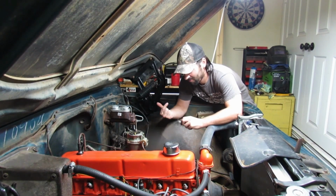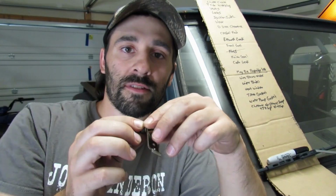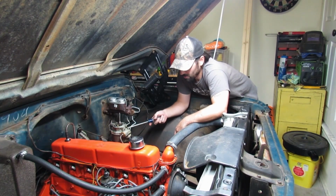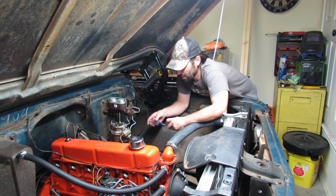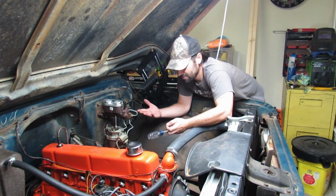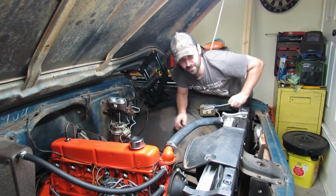If you take the bracket or the washer away, or both, it will grab threads and tighten up. We're gonna go with that because we don't wanna tear this all apart so that we can get in there and fix these threads when there's a chance that just tightening the screws isn't what's going to stop the gas from leaking, and then it's all got to come apart again. Does that make sense? I think that makes sense. Yep, that makes perfect sense.